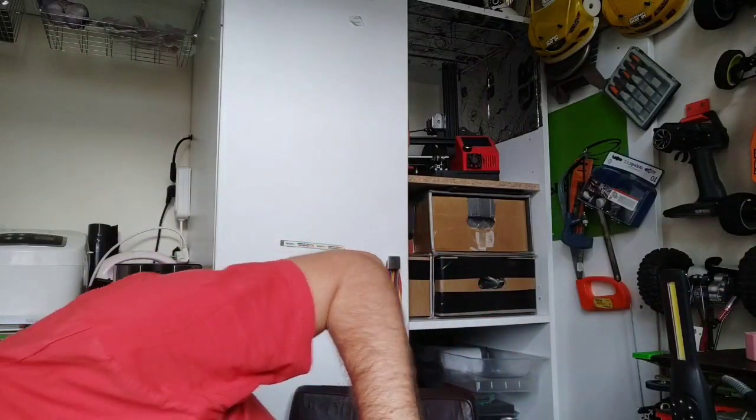I mean, this piece printed, it's okay. Again, you have to buy, as I explained, 4 screws and some XT60 if you want. Again, only if you want. I recommend changing to XT30, at least for the charger port, because it will be easier for you to manipulate this thing when you attach it to the plate or to the battery.